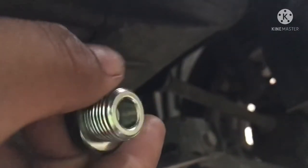Now we'll tighten it up — we already cleaned it. Don't forget the washer. Check if it has a washer before reinstalling and make sure it's replaced. For the gear oil, this is the gear oil drain plug, that's 24mm, and we've already drained it. Now we'll cover it — 24mm is the size. Also, I forgot to put the washer, so make sure to check the washer.